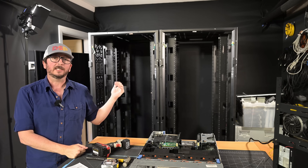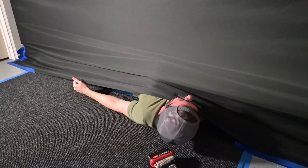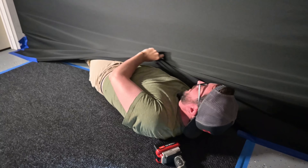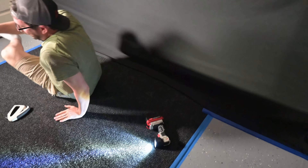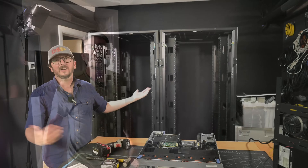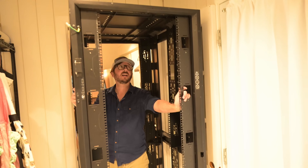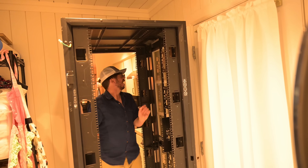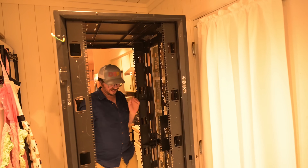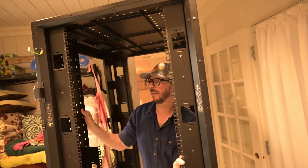Also think about which direction your garage door is facing. Most garage doors are large, metal — perfect radiators of heat. Having an additional air space between the garage door and the interior, even with an insulated garage door, that giant black tarp back there actually adds a great air space so hot or cold stays isolated and doesn't make it inside. Your standard 42U rack is going to fit through most doorways, especially even at larger widths with a 32-inch door. However, if you're looking at a 48U, that could be a big problem because you'll probably have to tilt it to get it underneath. So make sure if you're looking at 48U racks, you're really accounting for that extra height.